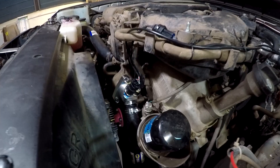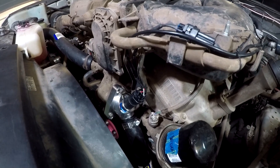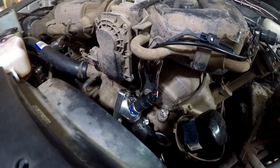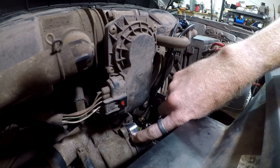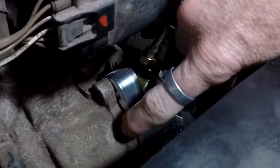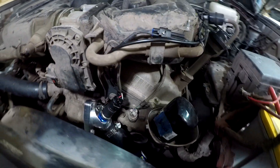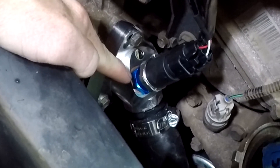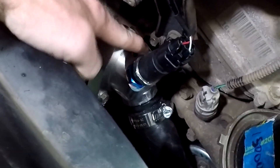There's the finished product. I've filled the system with coolant and I'm about to start it up, let it run, and watch for leaks. You can see the edge of the O-ring here if you look really closely — there's not enough room for the O-ring to squeeze out between the two housings. On this side I have the M18 by 1.5 to 1/8 NPT adapter with one sensor in it.